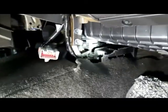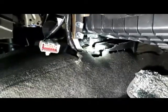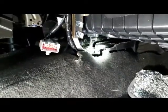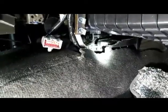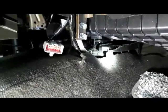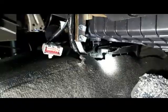Okay, so this is just a shot showing that with the ignition on, powered up, I was just able to cycle through the temperature, and it aligned the tab of where I need to put the screw on perfectly. So 60 degrees was my magic number, but it could be different depending upon when people deactivated their system and started tearing it apart. The index would be different. But that was something I haven't heard in all of the videos, so I thought I'd share that as well. Onward.